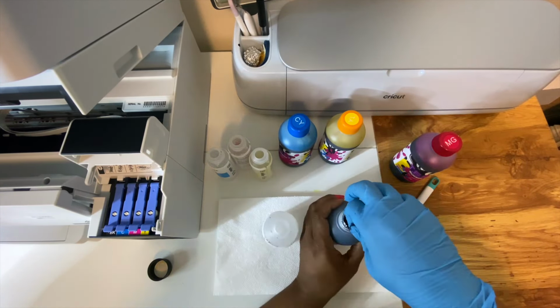All right, so today we are doing the Epson Ecotank 15000, and we are just going to click onto downloads. Now that we're here in downloads, the Epson system has already recognized the computer that I'm using. I am using a Mac OS, and so it pulled up the drivers and files that I need. I am going to select drivers and utilities combo package installer. What you want to make sure is you download all of the drivers, because that is where you will be able to get all of the print setting options. Once you've downloaded the drivers and utilities, you want to locate that file on your hard drive and begin the process of installation.